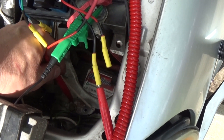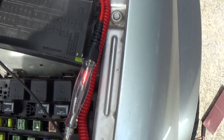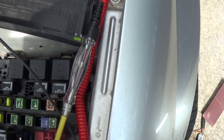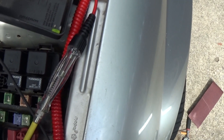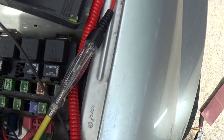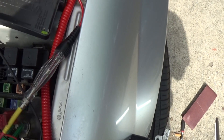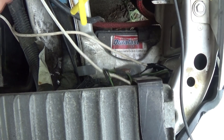First I'm going to clean up the headlight area — most likely my problem is in these wires. Somebody already cleaned up the post but you can see it lights up here — there's my problem right there. I'm good here, I'm good here, but nothing here. There are multiple wires coming into this point and nothing on some of them. I need to get all this cleaned up.